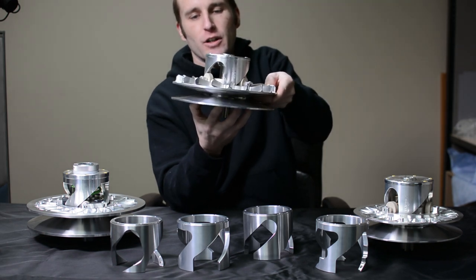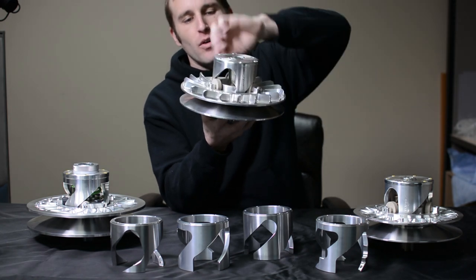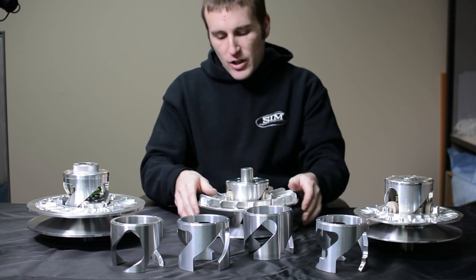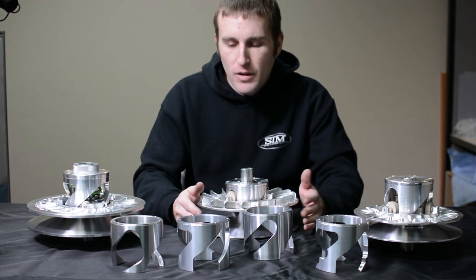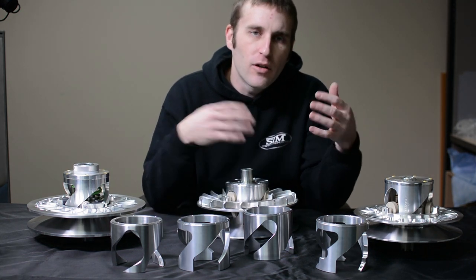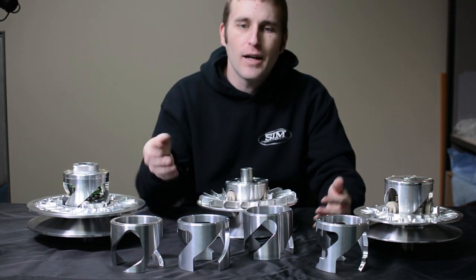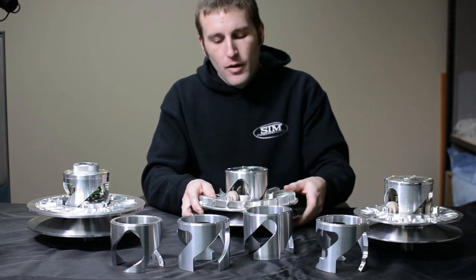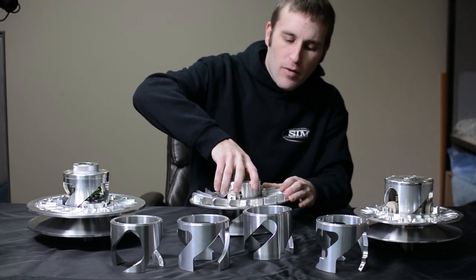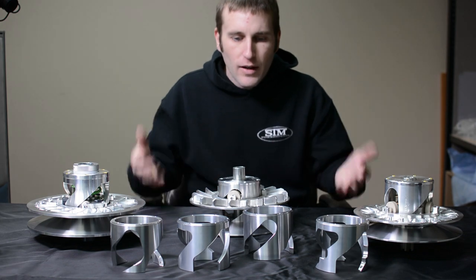As the angle changes, the height of the spring is going to change relative to how much the angle is changing on the shift. With a taller angle or a higher number, it's going to have more load on the engine — in effect, shift out faster. With a shallower angle, it's going to keep the vehicle in a lower gear for a longer period of time, which is more conducive for a larger tire setup or mud bogging, where you need a lot of torque at all times. A shallower helix gives higher RPM at every point throughout the shift, but realizes more torque.